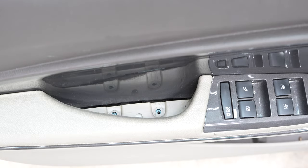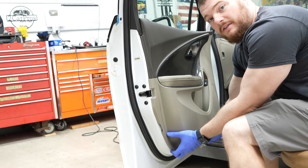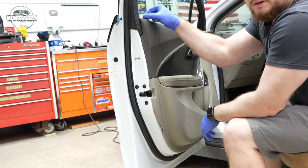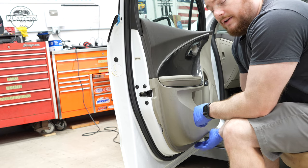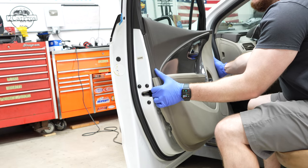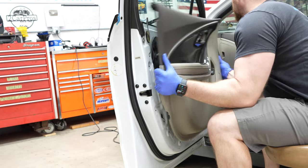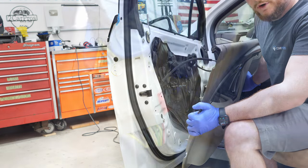With those three bolts removed, the door panel can come off really easily. Come right here underneath the door panel where the panel meets the door on the very bottom, pull and swing it kind of up and then off — that's going to free it from the lock plunger indicator. You can use a little prying implement on the bottom of the door panel, or just give it a nice little tug, and then at the top it hooks on so you just lift up and out.